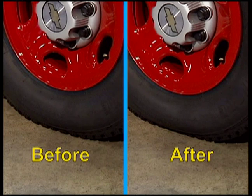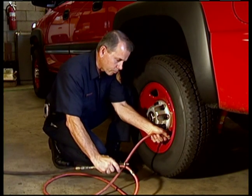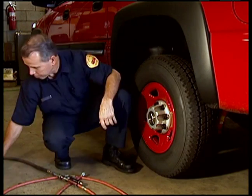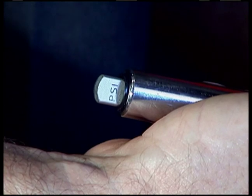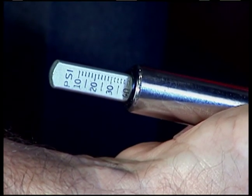This is why it is important to check your tire pressure with a gauge on a regular basis. A low tire creates more heat, causing premature wear and a breakdown in tire integrity, not to mention the loss in driving stability. As little as 10 pounds less in one tire can cause your vehicle to drift to one side while driving.